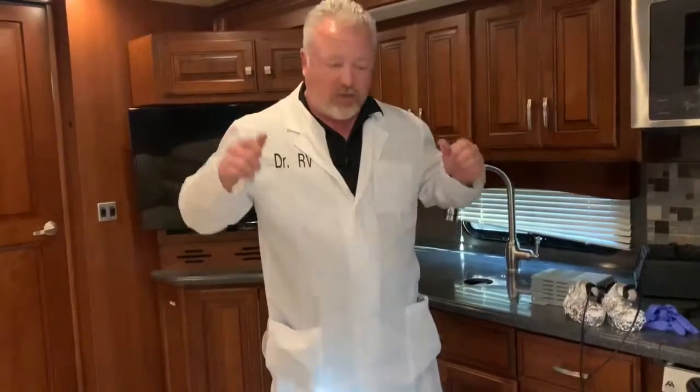What do I do, Dr. RV? I can't get it repaired — it's a Sunday. No problem, I'm here with a remedy. If you already have a battery charger with you, excellent — you're well prepared. If not, go to your local store and pick up a regular battery charger that you'd use to charge your car batteries. Plug it into the RV if you're on a generator, or into the outside shore power. Either way, connect those leads directly to the house batteries. That will keep your batteries charged, allowing your lights and components to work again until you can get a permanent fix, which is to replace or repair the inverter or converter.